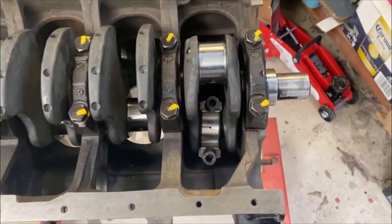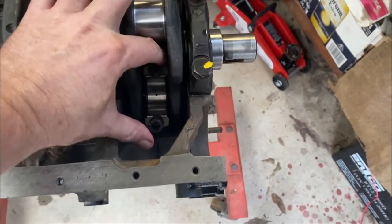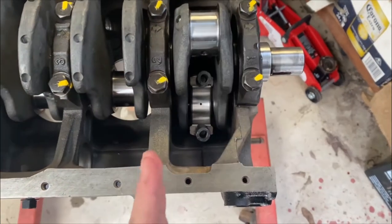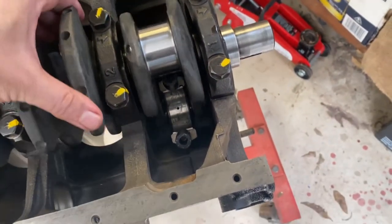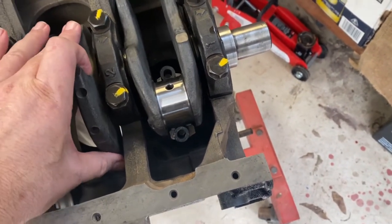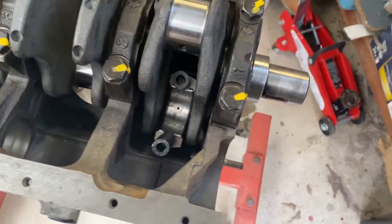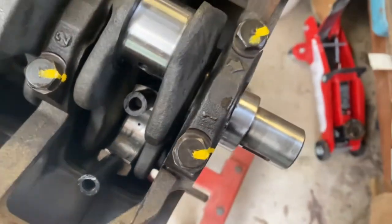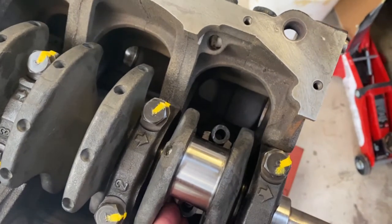Okay, as you can see at the flip side, this one's slightly twisted. It's just a matter of getting in there, making sure it's nice and straight, nice and straight in that dimension. Note that you cannot rotate the crankshaft around to meet the rod. It's too far out to the side. And make sure you've got your engine paste on. And then push the piston up from the underside, making sure that it's in line with the crank.